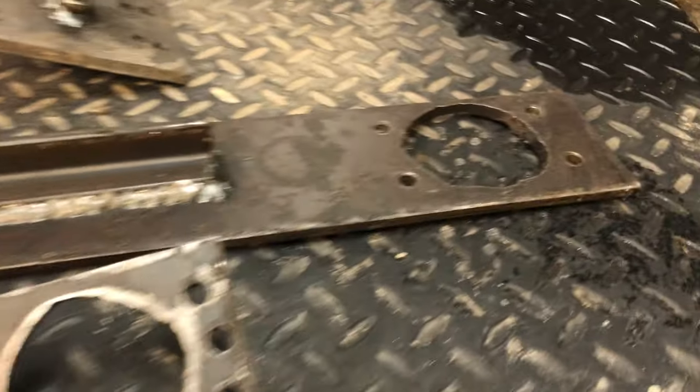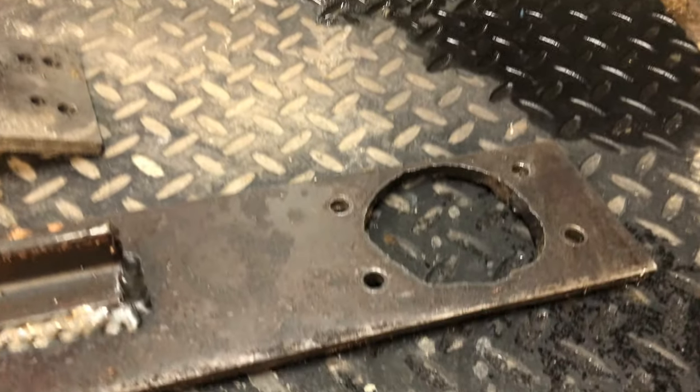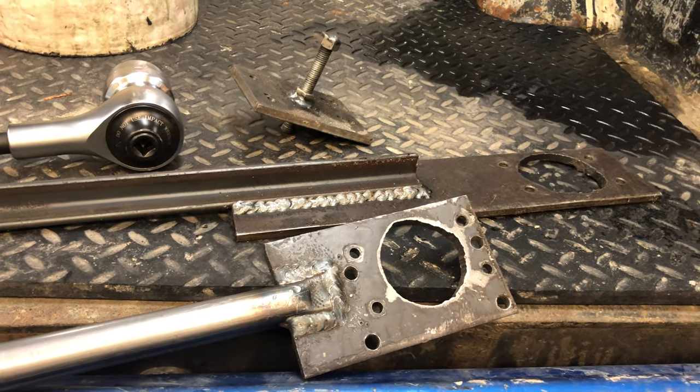This second one I made because I had to have such a big hole for that socket to get through it, which meant it was going to be too large to work on the yoke of the Dana 60 on the front. For transferring the bolt pattern from the yoke, once I had the driveshaft off I just took a piece of paper, put it on the yoke, and tapped it gently around the holes with a ball-peen hammer. That gave me a template I could carry over to the steel and drill out. You really need to be ready to hold those yokes tight as you're torquing or loosening them. I just made these things out of scrap — I'm not claiming expert craftsmanship, but it worked just fine.